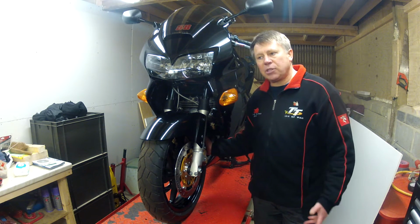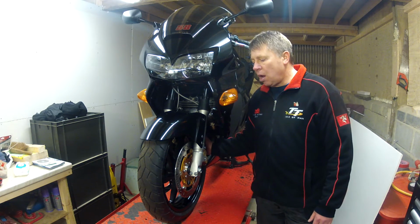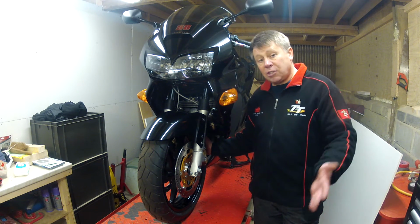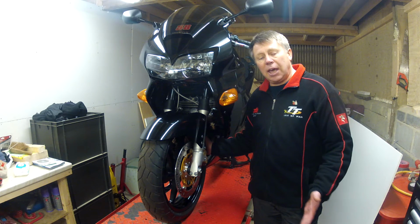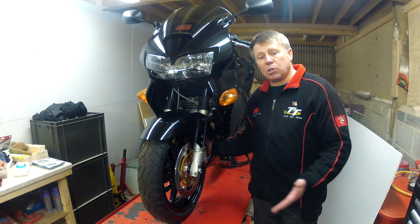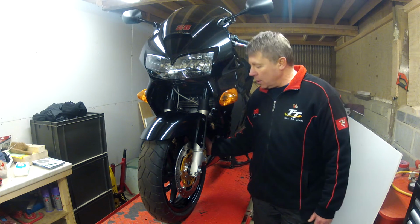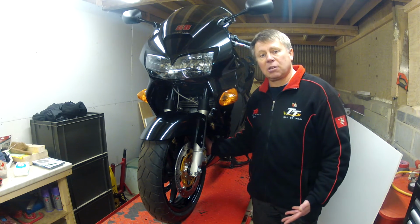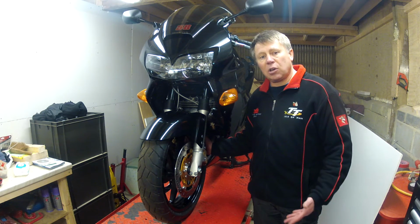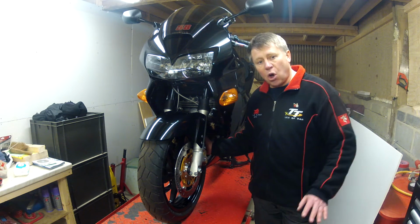I put this out onto a page, and I got really mixed results back, some really negative feedback. But I looked at the brake hoses in this, and I figured, well, they're 16 years old as well, and I thought, have a look at the replacement kits, and people like Goodridge and Hel were doing kits, and they were, you know, £300. It's like $450–500 US, and I had a look on VFR World at a guy who had delinked the braking system on his VFR. So I had a good look at that, and I thought, well, I'm going to do that. So I took out all the link braking system; it is now gone.